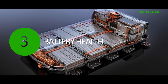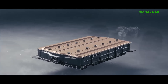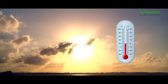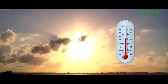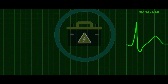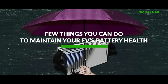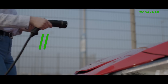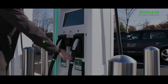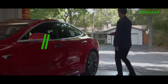Battery Health. The cells in an EV battery are made of lithium-ion, which is temperature sensitive. During monsoons, the temperature can drop after a whole day of rain or rise after a whole day of sunshine. This change in temperature can affect your EV's battery performance. But don't worry — here are a few things you can do to maintain your EV's battery health: avoid charging within an hour of use, don't overcharge, don't charge with an incompatible charger, and always charge in a dry area.